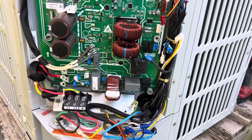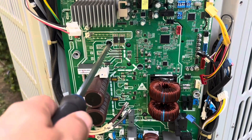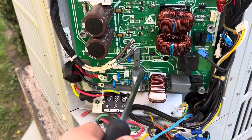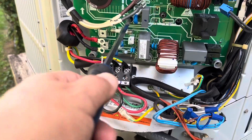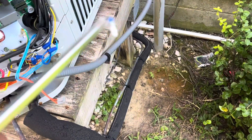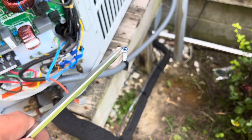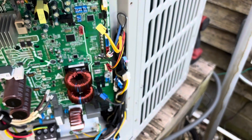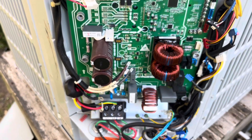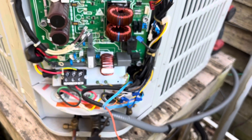We've got all the perimeter screws out. Now we want to take these four screws out — one, two, three, four. You want to be careful with these ones because they do have thermal paste on them and you don't want to get that everywhere. By the way, the kit gives you all new screws, mounting screws, heat sink screws, heat sink paste, and these little plastic pieces — it gives you everything, so don't worry about saving the old stuff.